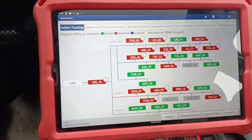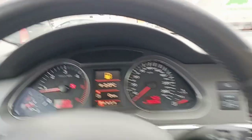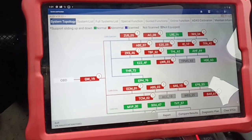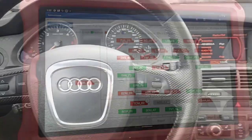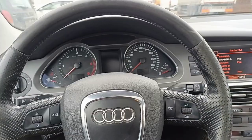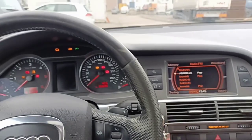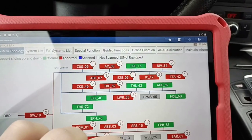This car has a lot of issues, but as you can notice there's no problem with the other ones — only the adaptive light needs to be removed. This is not coding; coding is when you install something in the car. This is to deactivate. I just removed the fuse as you can see. We still need on the left side to take the fuse from the instrument cluster after that, and then we switch on.